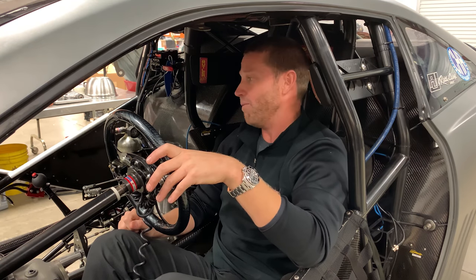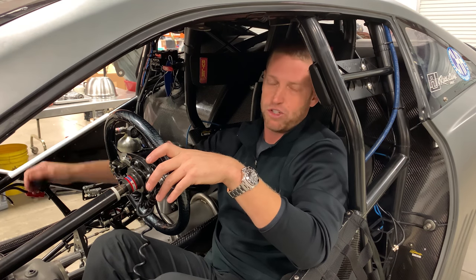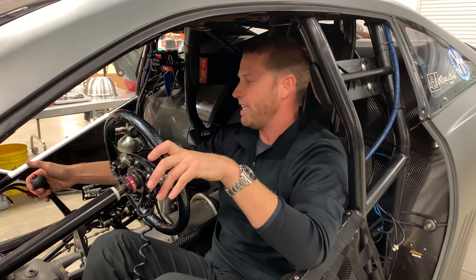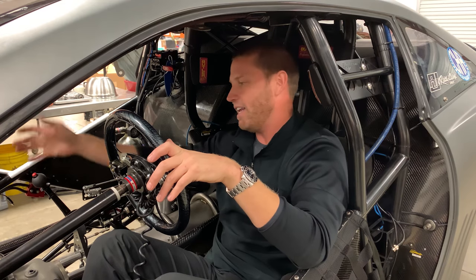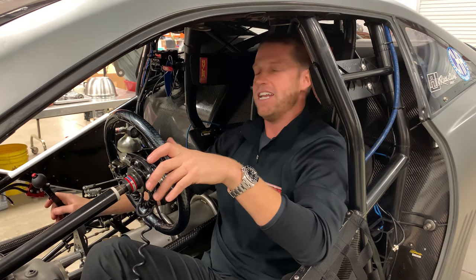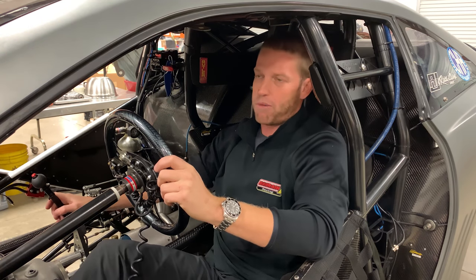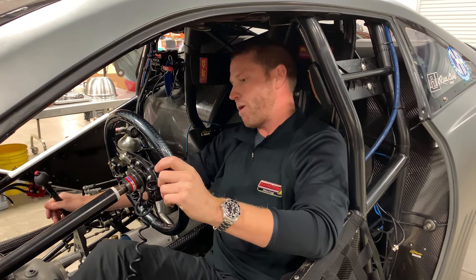With a supercharged car, we fry in high, meaning we do the burnout in high gear. So the button on top of the shifter, that's a shift override button. I'll hit that thing once, shift it into second, hit it normally when I'm rolling into the water, shift it into high gear, and it's ready to do the burnout. I'm rolling through, of course, foot back on the brake pedal.